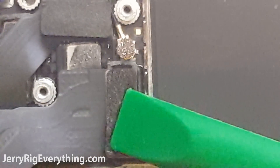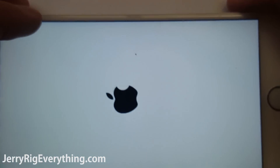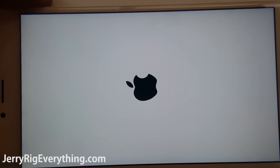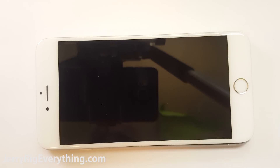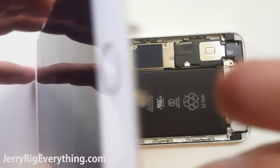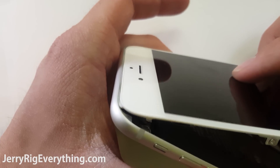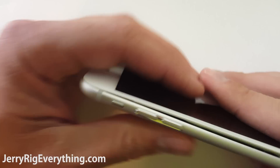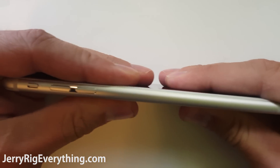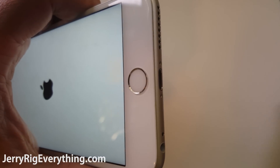Before putting the metal plate back on, test it and make sure it works. If you have any lines running through your screen, or if it's grey or discolored, try reconnecting those ribbon cables — there's a chance one of them is not sitting quite right. Everything is looking good, so turn off the phone and install the metal plate. Get the 5 screws back into place. Line up the top of the screen first — there are little plastic grooves that slide into the metal frame — then press down evenly on both sides, snapping it down all the way around the edge. Make sure you get your bottom 2 pentalobe screws in and you're set.